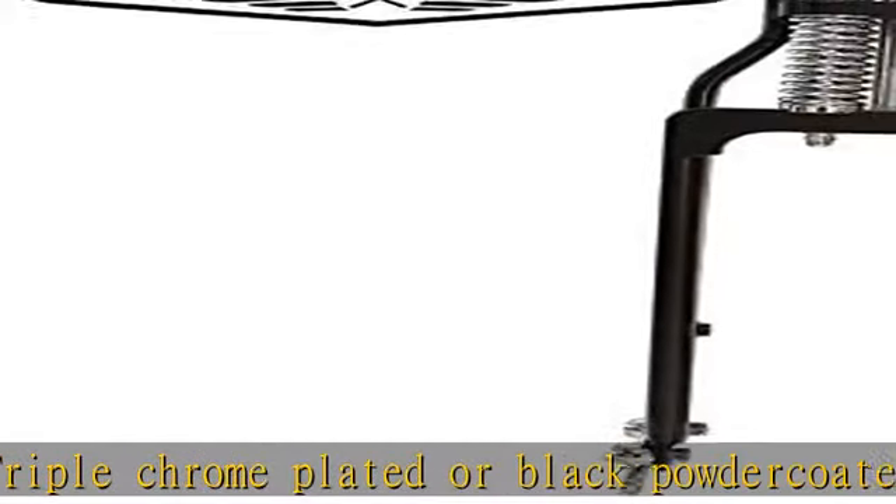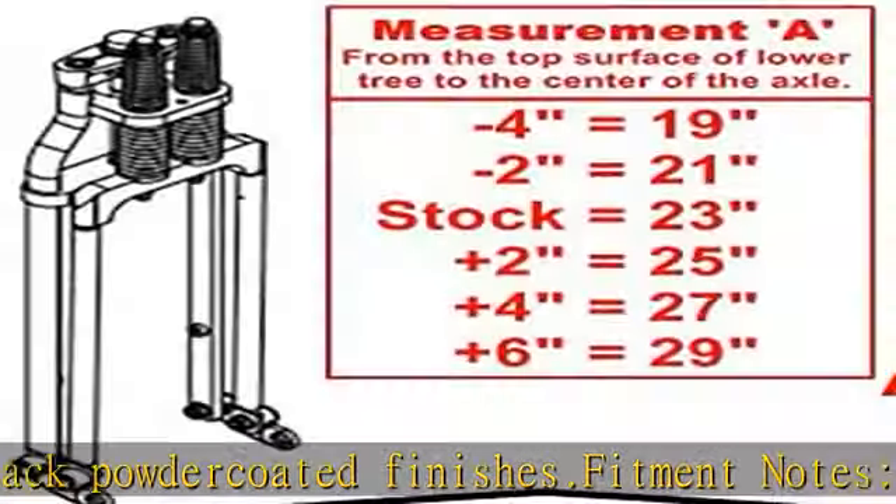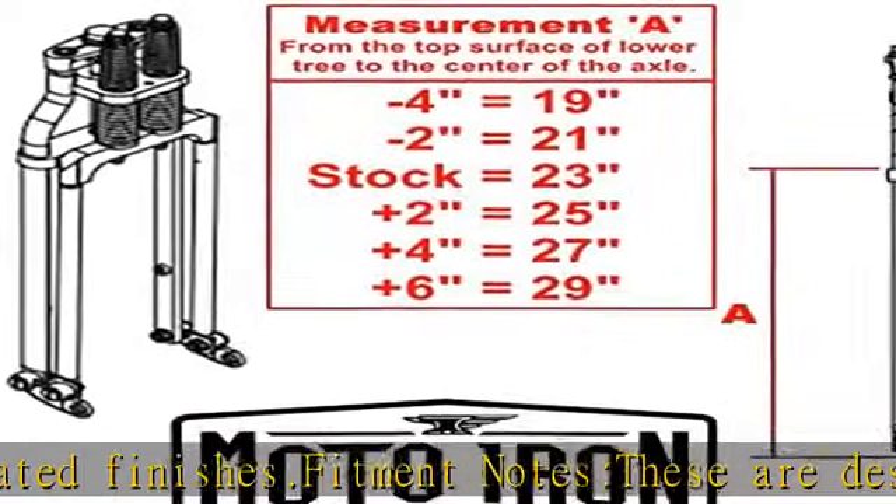You can run other wheels such as narrow glide, etc., but you will need to cut your own wheel spacers in order to do so. The top tree accepts 1/2-20 fine thread risers, and the riser spacing is 4.75 inches center to center, same as OEM Harley springers. Keep that in mind when purchasing handlebars. If you want to run Harley OEM style handlebars with 3.5-inch riser spacing, you will need to purchase a riser adapter kit.